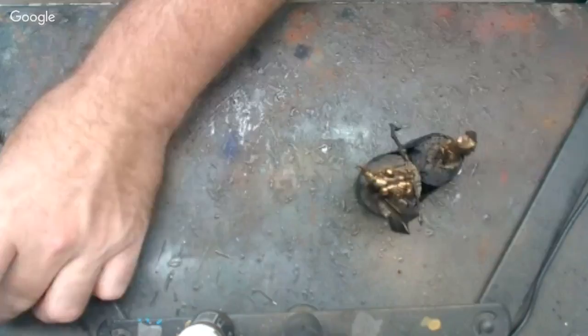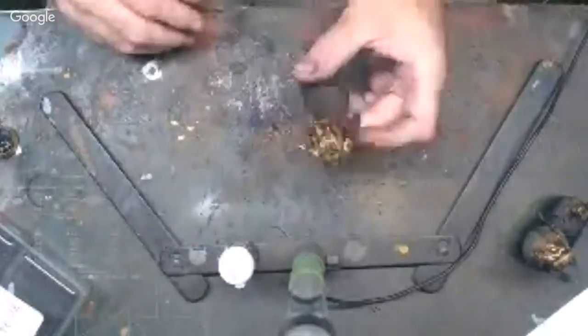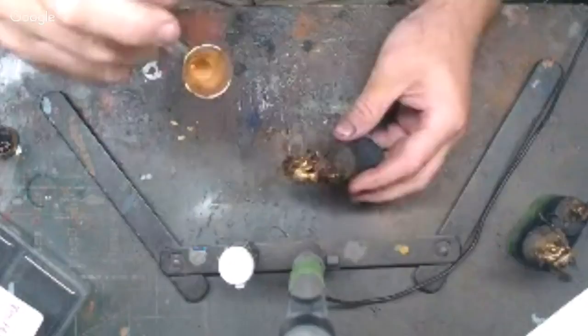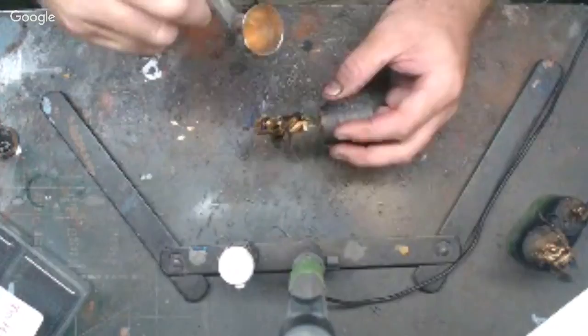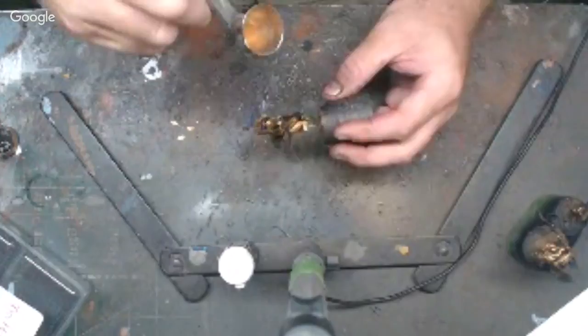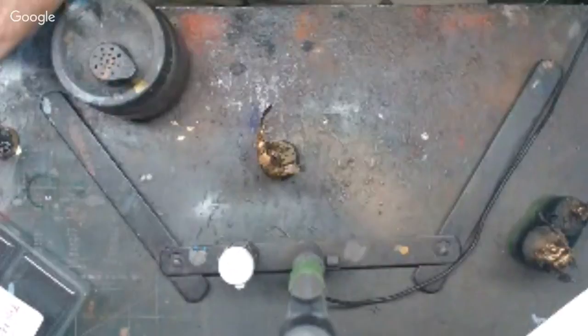45-degree angle like I always do. I'm going to raise this up a little bit more because I feel like I'm a little too close. All right, once I keep the mic from smacking me in the forehead — here we go, 45-degree angle down with our next color. Now it's very important to get really good coverage with these golds because these golds are really going to make that candy pop. You can do it with silver bases, but I find that using a gold base creates a much richer candy red for the paint job.